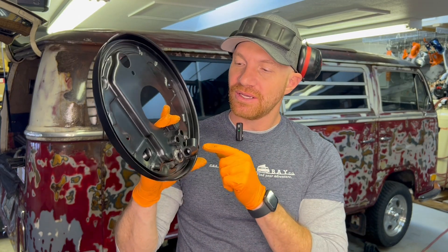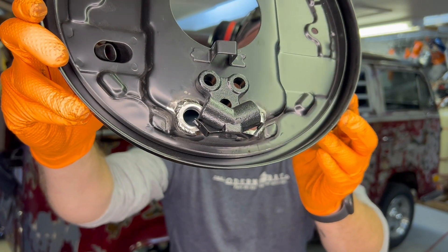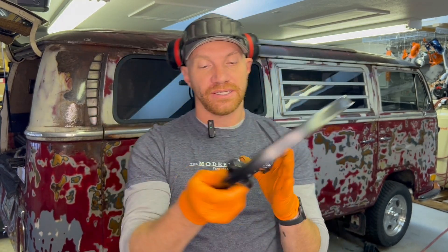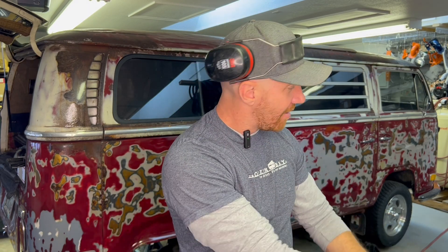Here's something I'm maybe a trade secret — I'm proud of this. What I do is take what's called a clipped washer — just a washer with a clip — and I weld it all the way around the adjuster hole on the backing plate so there's a lot more metal there. Because if you go to adjust these beautiful new brakes in a year you'll be fine, but if someone tries to adjust them in 10 years maybe the adjuster is seized up and they start forcing it. Now these have beefy welded-on washers to keep you from destroying the housing when adjusting. I'm probably way more proud of that than I should be.